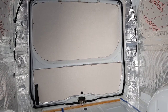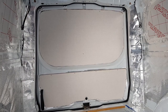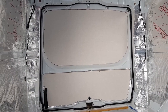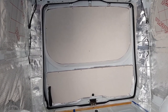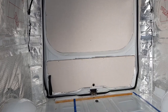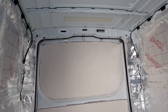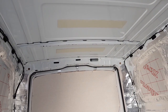The panels on the back door are fitted first time so I'm really pleased with that. I'm pretty sure it will all look even better covered in the grey felt that Connor's got. I also want to seal around the edges just on a belt and braces basis. One more quick tip: when I'm drilling into these pillars I use a block of wood so that the drill bit cannot go through the outside skin, which would be just a disaster. Still waiting for the stick pins and I'll show you how the roof panels go on when they arrive.